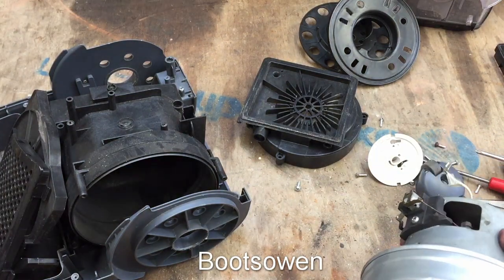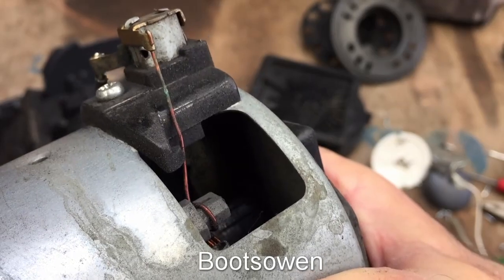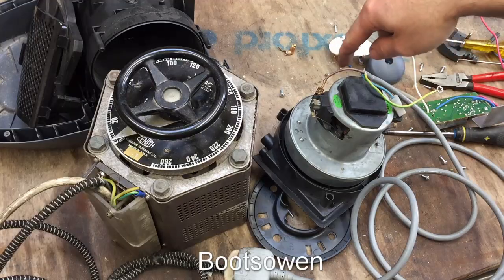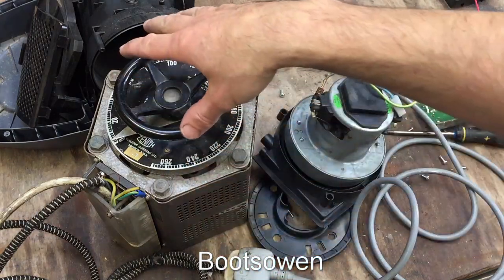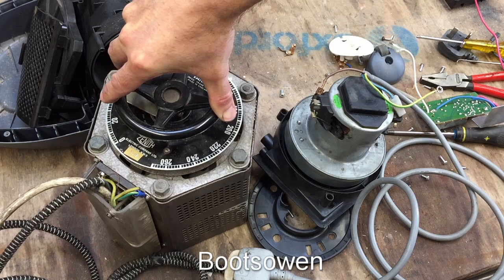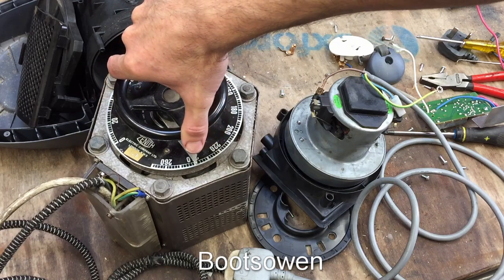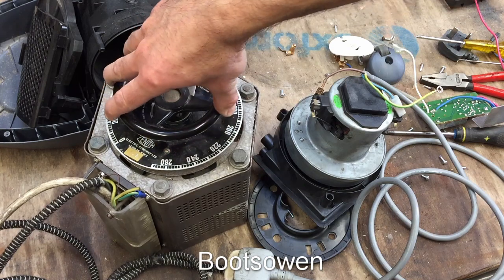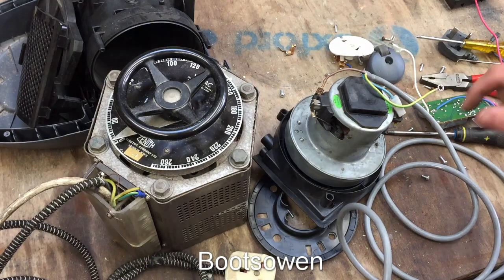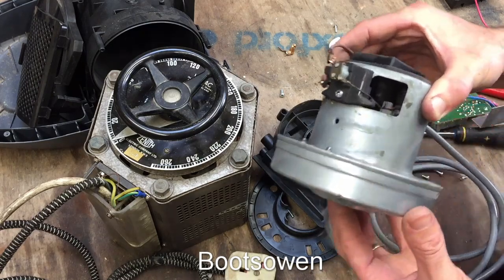So let's put power on this and see if it makes a cloud of black dust in my garage. It does spin freely. I've got power going to the motor through this plug, through the Variac, which is at zero and can go up to 270 volts through the magic of transformers. Let's bring it up — see if it explodes and starts sparking. 80... 160... a hair of spark. That's the full voltage there — getting nothing from it. I think that motor's just dead. The cable says Dyson on it, I don't know where that came from. Hasn't gotten hot — I'd say it's cooked. Completely cooked.